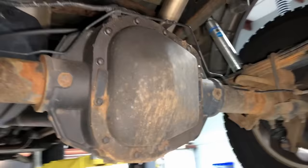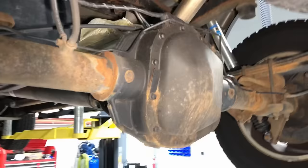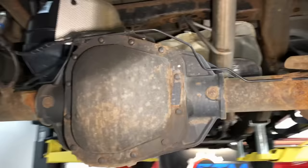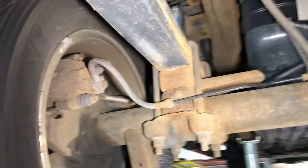Moving on back to the rear differential. It's just air-cooled and doing work at all times. If you're just driving along with no heavy towing, you can wait 60,000 miles. If you're towing a lot or using the truck for heavy loads — a construction truck, for instance — you want to change the fluid every 30,000 miles. Rebuilding a rear differential with ring and pinions precisely machined is not cheap, and clutch packs aren't cheap either. There's lots of labor involved, so a rear differential failure is surprisingly expensive. Change the fluid and keep that at bay.